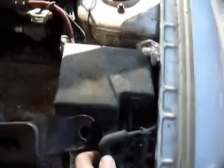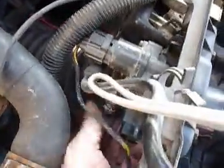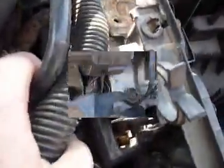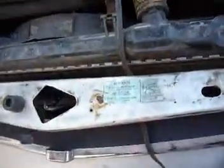On the air cleaner, pull this little line apart, disconnect this electrical connection, and the hose is out of the way. You've got a 10 millimeter hold-down bolt here. If you don't have a screwdriver handy, you've got a 5/16 socket you can use to take this hose off.